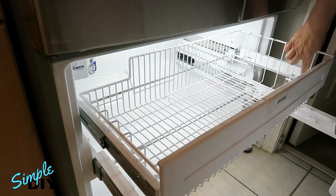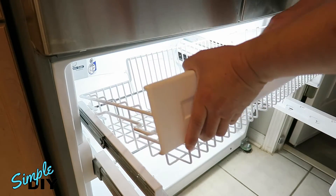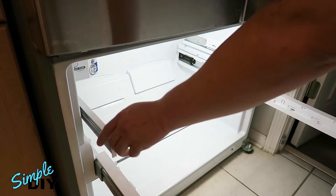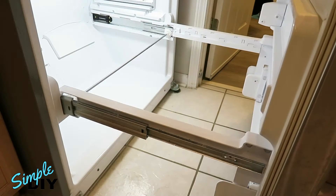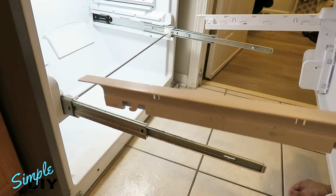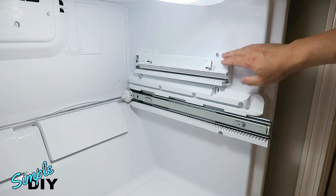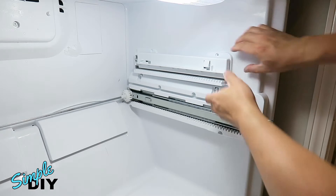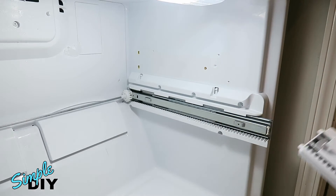Pull the top tray out. Press in the two tabs on the side to release, and now you can remove this rack. Push these rails back in. On the side of this rail there's a Phillips screw you need to remove. Now you can lift the front door up and remove the door. Push the sliders back in. Next, remove the top track — it's held in by two Phillips screws right here. Do the same thing for the other side.